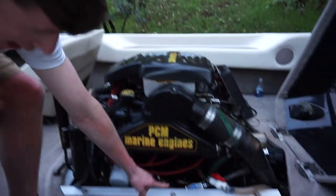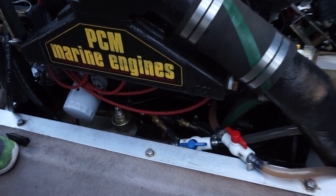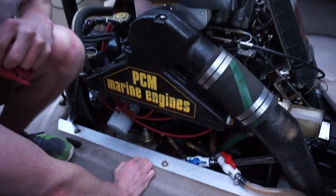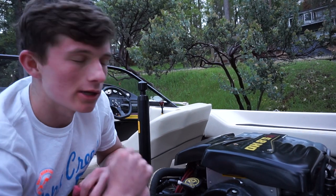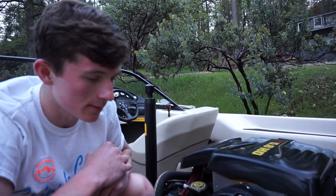You also want to look underneath the engine. Make sure there's no oil leaking, or gas, or especially water — because if your engine froze, you would have a lot of water leaking out of your heater core. It's just steaming because the engine is warming up right now and it has a little bit of condensation on it from sitting over the winter for a long time.